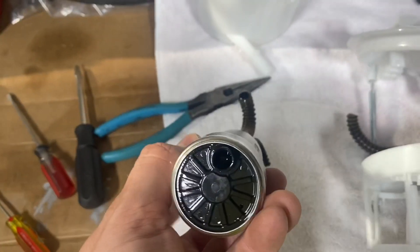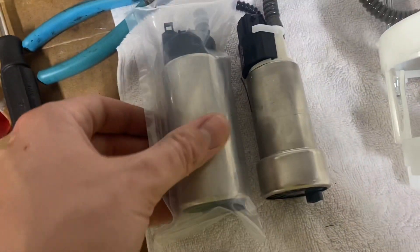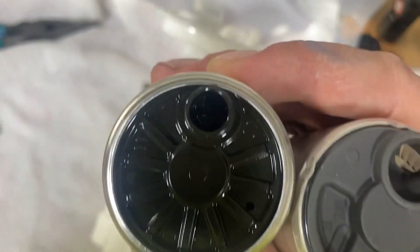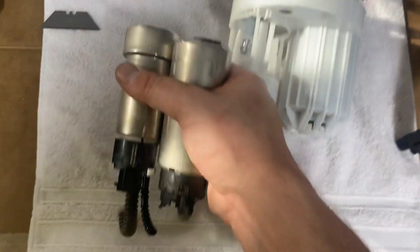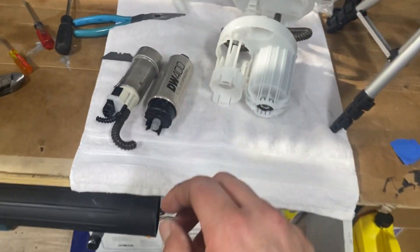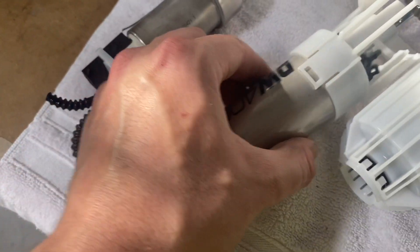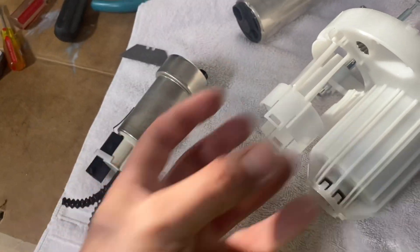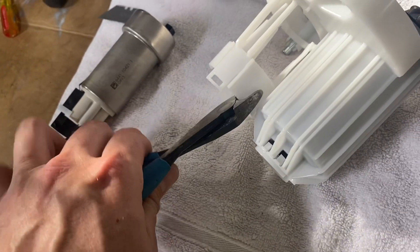Comparing the inlet against the new pump - right off the bat, the new pump is a lot bigger. We are going to have to trim down here in order for this to slide up into place because it won't fit otherwise. The DW400 inlet is way bigger than the stock opening - it's going to suck in a lot more fuel, which is another reason why you don't want to run these things low on fuel. Don't be ripping on your car with under a quarter tank of gas. Just take a pair of dykes and cut right here - that'll let this spread out and you can slide that up in there. Make sure you've got a nice sharp pair of dykes.